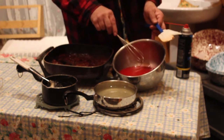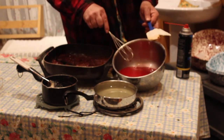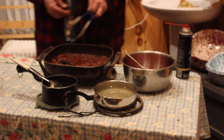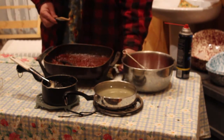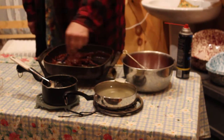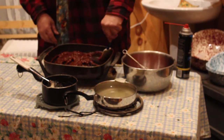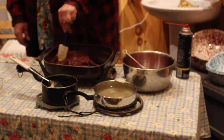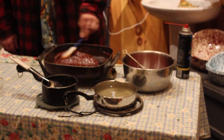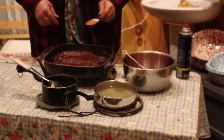We have this nice punch red mixture of acetone and automatic transmission fluid. This makes a great penetrating oil. I've seen lots of guys using it. I'm very excited to get after that myself. And then finally, we have our beautiful 50-50 mix of the high temp red grease and Marvel Mystery Oil. This has a definite scent to it. Nearly heavenly. Doesn't even smell like the foreign auto shops. Very nice, very nice.